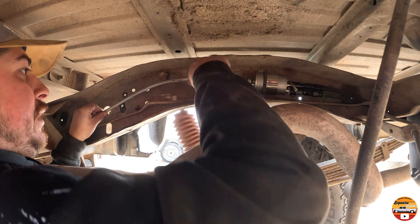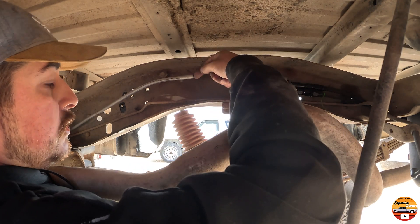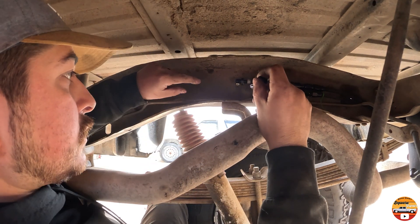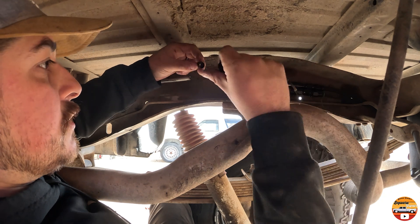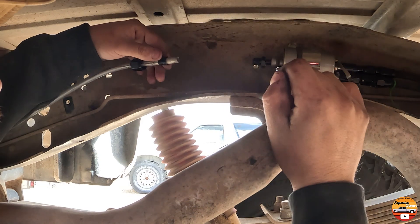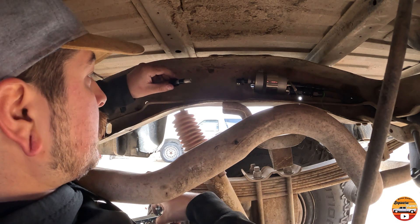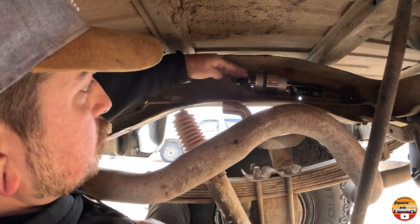How do we adapt our tubing to our fuel pressure regulator? We could use a hard line to AN adapter like we used on the fuel tank, but then we'd have two male ends and would run another AN line between them. What I'm going to do is actually flare this line and add an AN nut to it. This is an AN6 tubing nut, and it comes with these little tubing sleeves. You put the nut on first, then the tube sleeve, and then we're going to flare this and we'll have a nice little AN line. These are a lot cheaper than adapters - you can get a tube sleeve for about $1.50 to $2, whereas the adapters are usually about $6 or $8. I got a 10-pack of these for about $20, and a 4-pack of adapters is about $28.